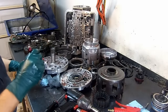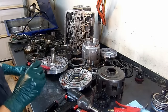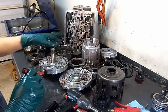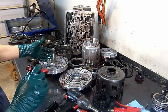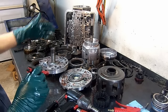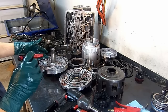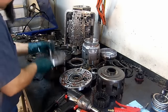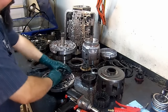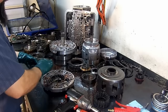If you want to see the damage on these babbitt bushings, you can go to the other video that I have on why it's important to replace the bushings, and you will see this exact same unit, well, not this unit, but another 4L60-E that had that same issue with the input shaft and the stator support being damaged. Okay, now let's remove the rotor from the pump.